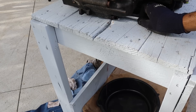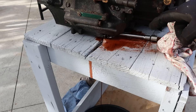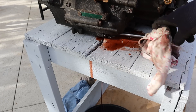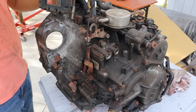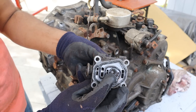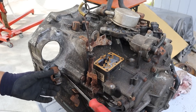First thing I'm going to do is drain this transmission. The previous owner said the transmission oil was burnt, but this looks brand new, which means they probably tried switching fluids before condemning it. We'll start by removing all the 10mm bolts that hold the solenoid switches on. Here's the solenoid housing — you can see there's a small filter inside of there. Here's the other solenoid housing, just popping off these little switches.